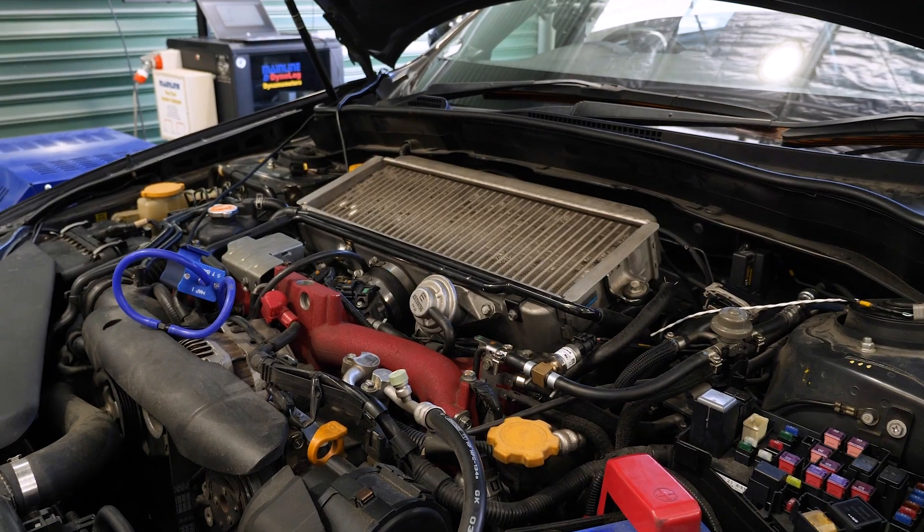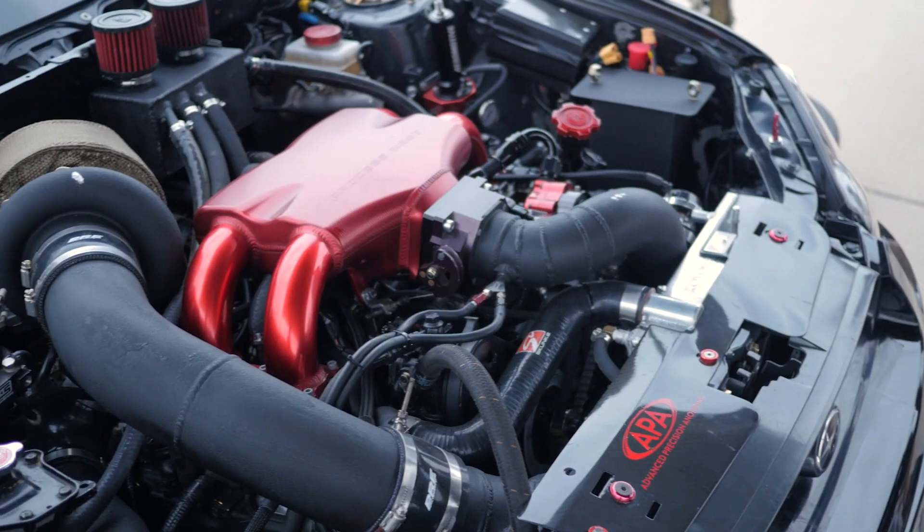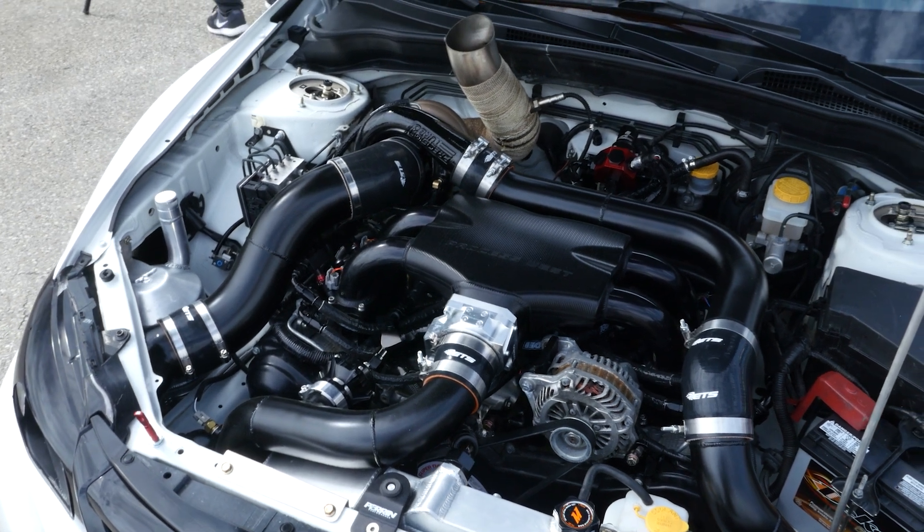So before we get into the specifics of the cylinder head Herman, what are the limitations or problems with the EJ head that you are trying to solve? They crack — simple. EJ20s are known for lifting heads and cracking them, so we wanted to start there as a stepping stone on a smaller, cheaper, more compact head before rolling out our six cylinder stuff.